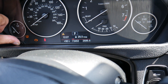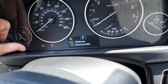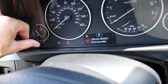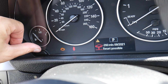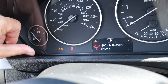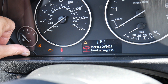Once it clears, press and hold that button — the service menu will appear on the dash. You can select the service you need to reset — only reset it if the service was actually performed. Select the item, hold the button until 'reset possible' appears, then select it. Hold until the reset question mark appears, let go, press down again and hold until it turns green.